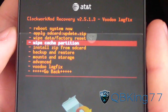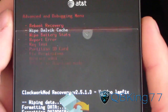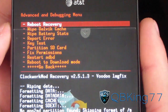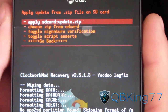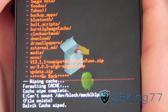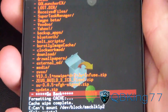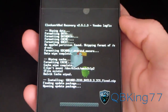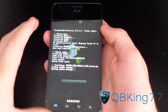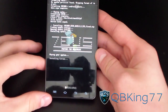Once you're done with your data wipe, go to Wipe Cache Partition and hit Yes, wipe cache. Then go to the Advanced menu and hit Wipe Dalvik Cache and hit yes. So once all three of those are wiped, you're ready to go. Go back and hit Install Zip from SD Card, choose zip from SD card, and navigate to wherever that ROM file is — that Zeus ROM. Select the ZeusBuild3 Ice Cream Sandwich ICS fixed.zip, hit yes, and go ahead and let it install.